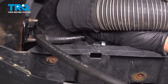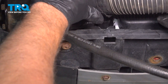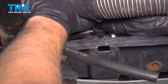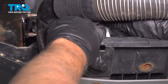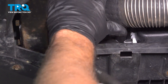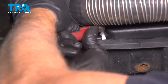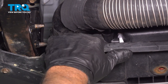If you want it to go a little faster, you can take the radiator cap off up top. Once the coolant's all drained out, we can close up the drain. Twist it to the right. You don't want to tighten it too much — just be careful using pliers. Snug it up, then take the hose down.